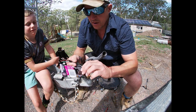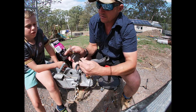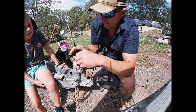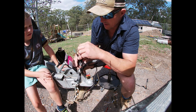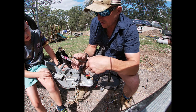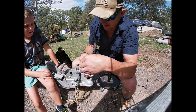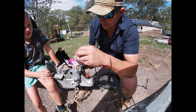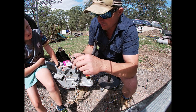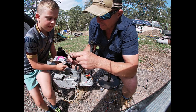So we've got: signal left is yellow, red is stop, blue is the service brake, white is earth, black is the reverse light — which we don't have. You'll see them zipped off in these things because a lot of trailers don't have reverse lights. Brown is the tail lights, and green is the right indicator.